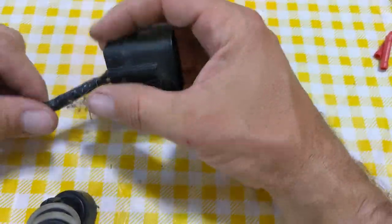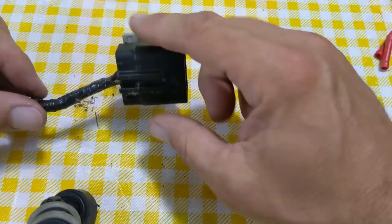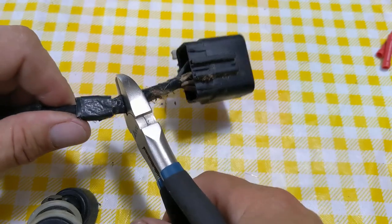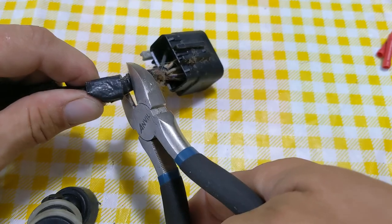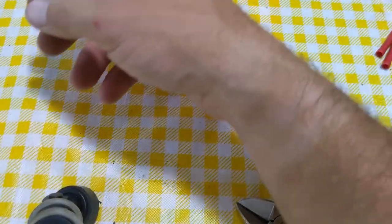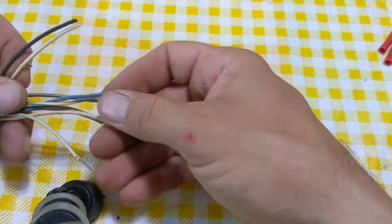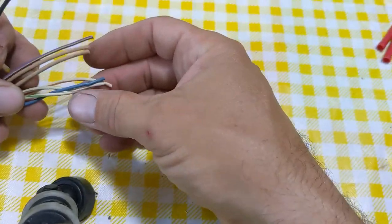So here's the old one. I'm using the old wire here as a demo so it won't be exactly the same - on the vehicle this will be green. All I would do is go ahead and snip all these wires off just like this, to get rid of the connector, then peel back all that insulation so we have all the wires by themselves.